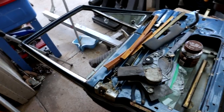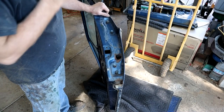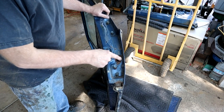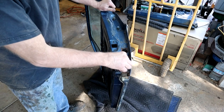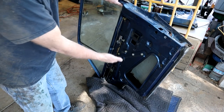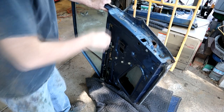This door has got to be completely stripped down for prep and paint. The inner channels have some surface rust on the bottom — purely surface, I'll clean it up and treat it. This is the rear door — there's some rust damage here where wires and vacuum lines come out for central door locking. Moisture got trapped, rusted out the hole slightly — needs cleaning up and a tiny bit of metal welded back in. Overall the door is not in bad shape. Neither of these doors had the plastic sheeting on, so someone had painted it blue from the original 050 white but never put the plastic back.